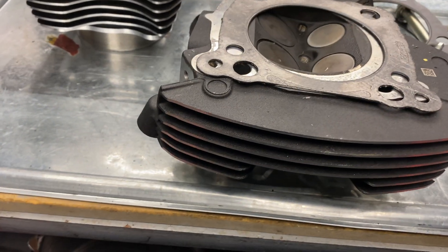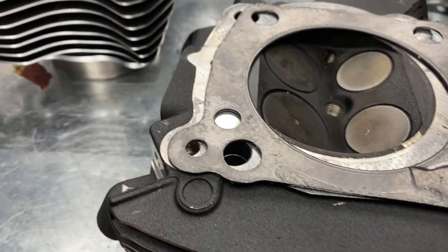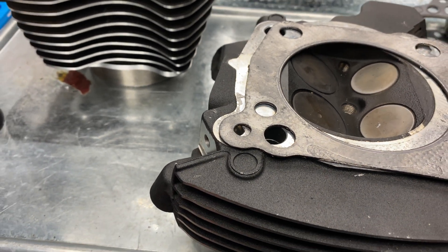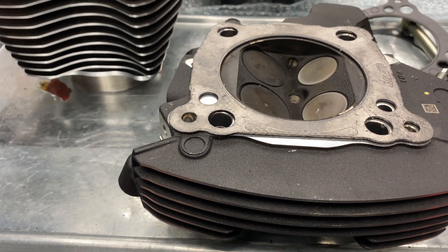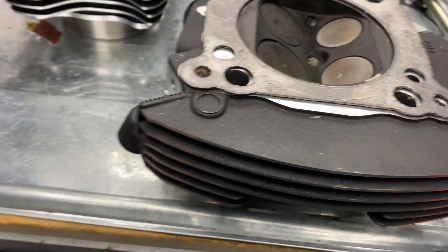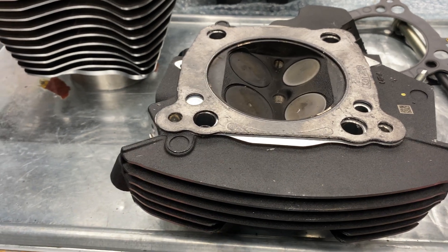With the firing ring on the inside of the actual gasket, if this is damaged in any way we're going to see a change in behaviour of the motorcycle, especially when it comes to extreme heat, detonation in the engine, and high operating temperatures. So we do see on teardown — commonly — scenarios that explain the situation.